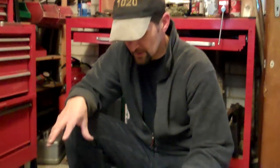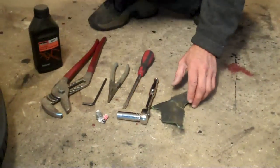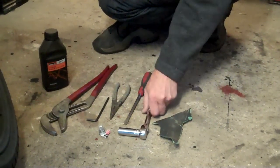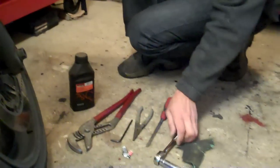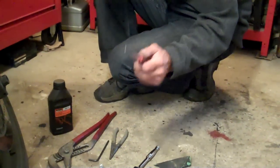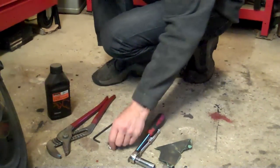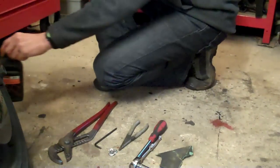Today what we're going to do is change the brake pads. It's a very straightforward job, shouldn't be as scary as it is. Kit list: what we need for the job is a pair of grips, some sort of grips or a G-clamp, a socket to get the caliper off, big old fat screwdriver, some thin-nosed pliers, 5mm Allen key, some copper grease, and a drop of brake fluid.